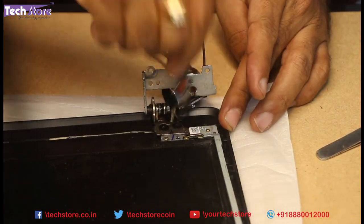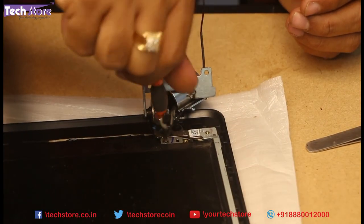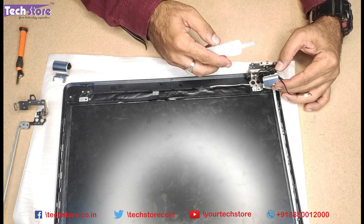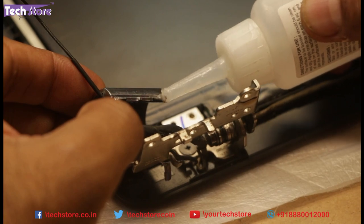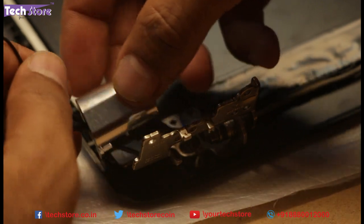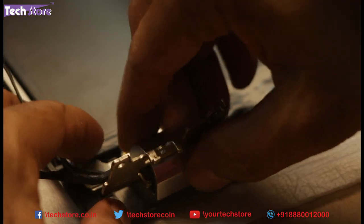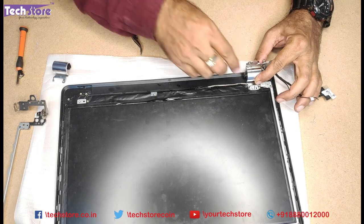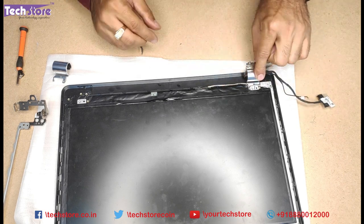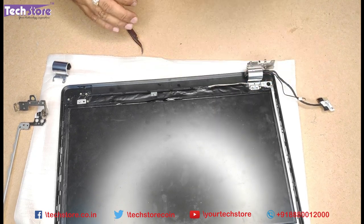Use the bigger screws. As you can see, the lock has gone off — there is one lock here and the other lock has gone off. We need to apply a little bit of quick glue to this particular area and send this part down to get it stuck. Just hold it for a little while so that it sets fine — within around one minute it should set absolutely fine. Then apply the screws that are required. This part is done.